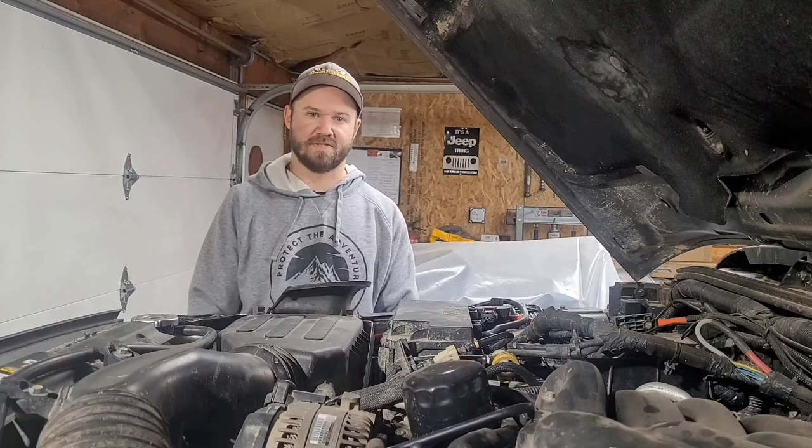Knowing how these are designed, I'm not surprised it doesn't eliminate completely. I'm a little disappointed because they do claim this product will stop the dry start, but it does not. It just improves it. The noise you hear there is likely the rockers and the lifters clattering on each other until the lifters are primed. The other thing, that noise could be coming from your timing chain, because you do have a hydraulic timing chain tensioner. I am a little disappointed it didn't completely solve the problem, but it looks like it's an improvement, so I suppose that's a win.